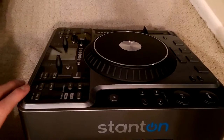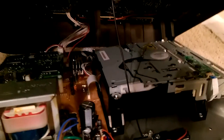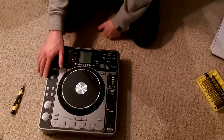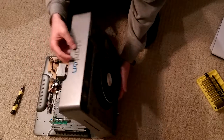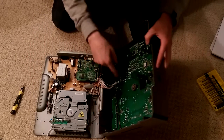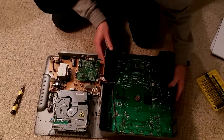Now that we've taken apart the housing, you'll notice that on the left side when you open it up carefully, you're going to see this black wire here. It's connected to a screw right at the end. You'll need to remove that first before you flip the housing over. That way we'll be able to access the motherboard and all the components there. Now that I've removed the screw from that black wire, you should be able to lift the housing over. Turn it carefully because there are a lot of wires you don't want to break, and just set it to the side.